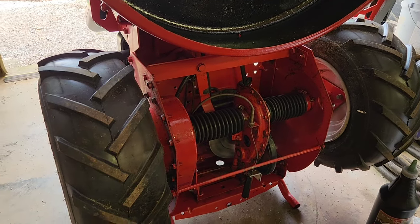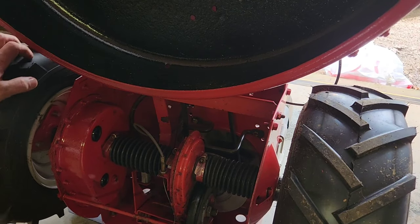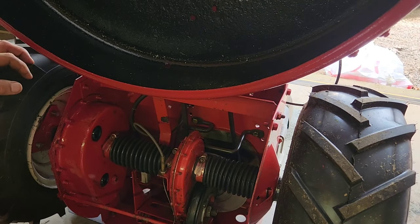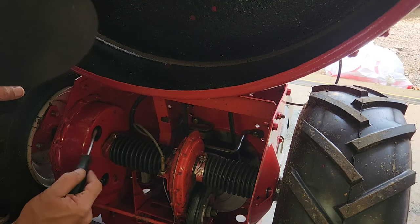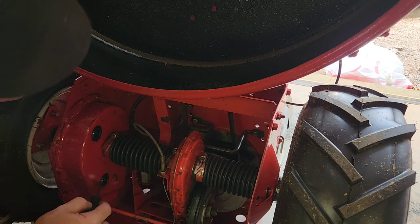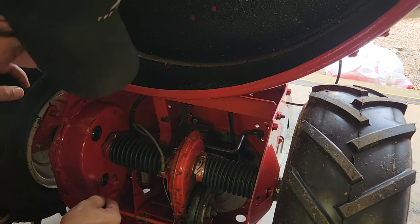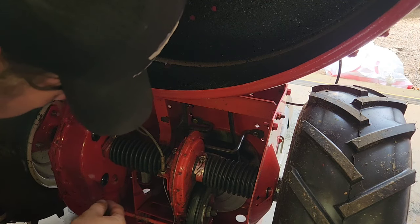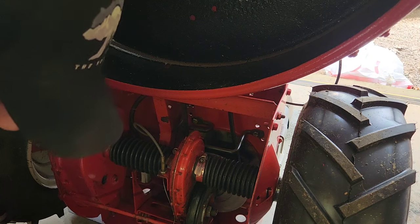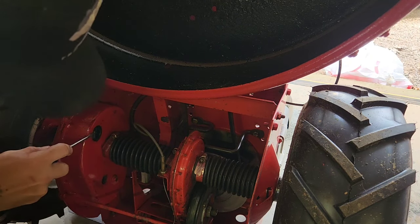All right, so let's move this, show you the differential. Now on this one, it calls to fill at the top. You remove both, fill at the top until it starts coming out of the bottom. I'm not sure why exactly, but I'm gonna do it like they say to,